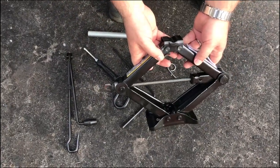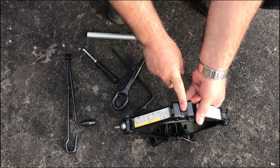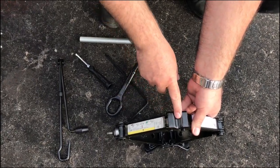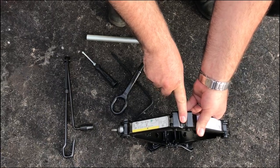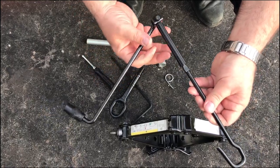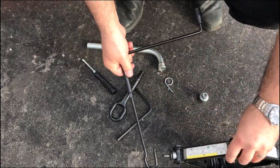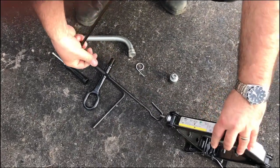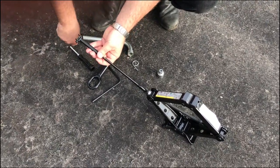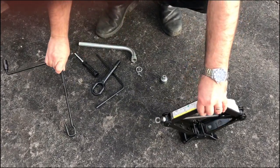This is the jack. It's called a scissor jack, and it's designed to lift the car up. The pinch weld, which I've shown you guys in the shop, where you put the auto lift pad, this goes there with the scissor jack. And this is the handle of the scissor jack. They vary a little bit, but really what they are is a twisty thing. So I'll put it through the eye of the jack here, and then to lower and raise the jack, I just turn it clockwise and counterclockwise, and it'll lift the car. And it will lift the car really easily, surprisingly.